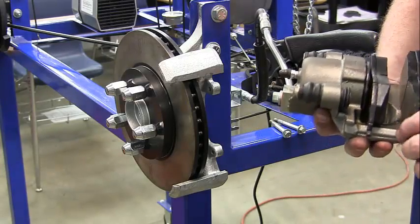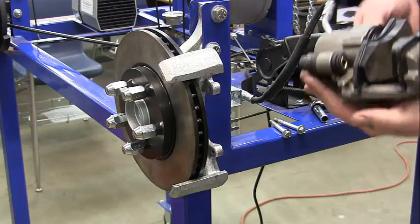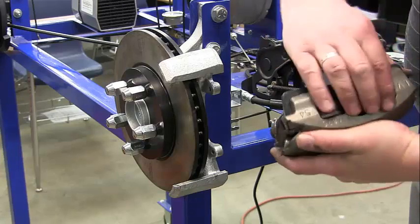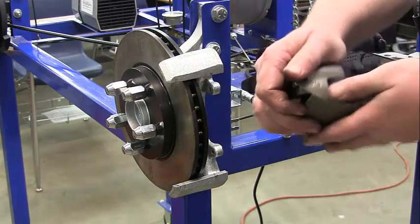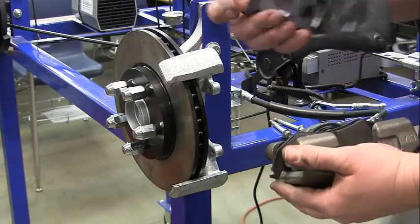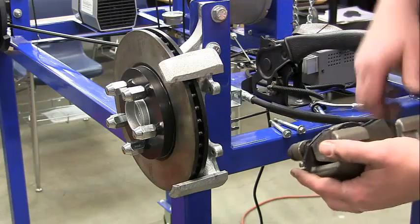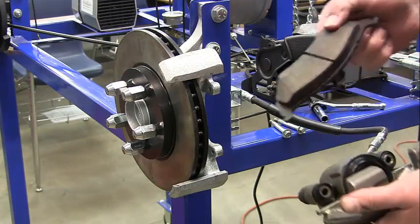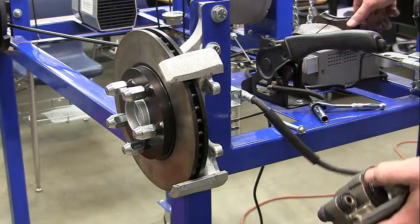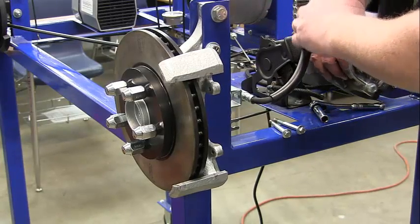That's as far as disassembling this. We want to check our brake pad thickness right here — we want to see how thick our pads are. Go ahead and take these out. This type has this little spring right here; you have to lift it up slightly and it slides out. Note the thickness of the pad and the condition they're in, then set it off to the side so we don't have any stress on the hose.